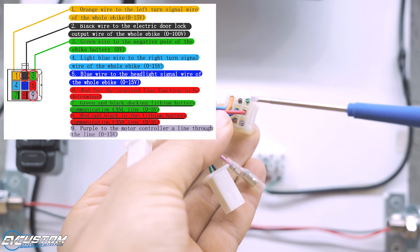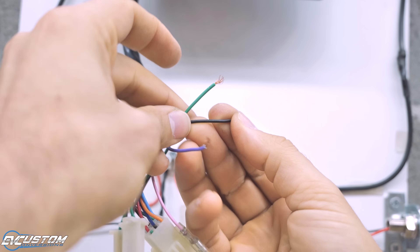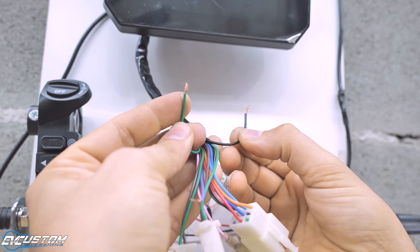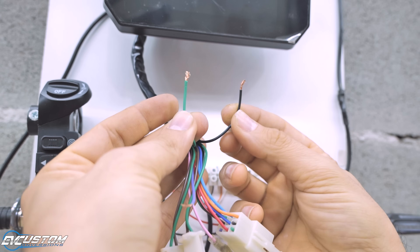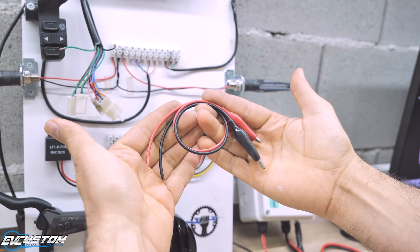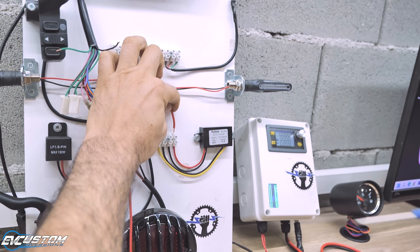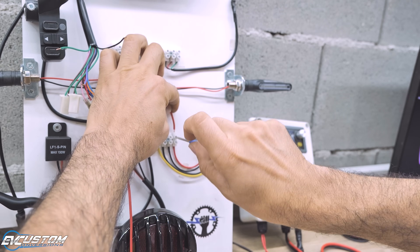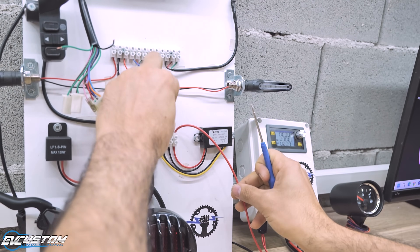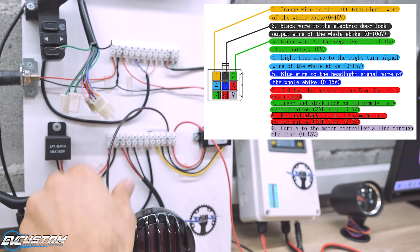As we said before, we have cut pins 2, 3, and 9, from which pins 2 and 3 must be connected to our battery for the power and voltage readings. Now let's connect power to our panel through the step-down converter. For those wondering why we need a 12V step-down converter: it is because our screen can accept input signal up to 15V max, as you can see also in the manuals.